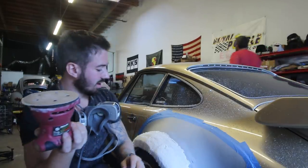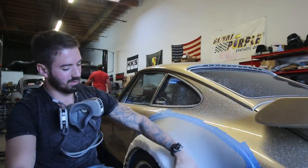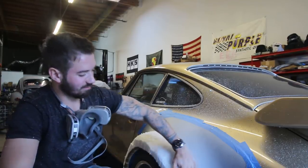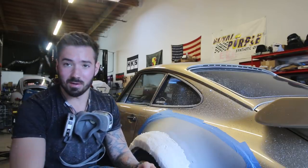Now that I've cut the bulk away with the knife, I've switched to the sander. That gives me a little bit more control over how much material is removed. At this point it's just like any other standard bodywork, but I don't really have much besides the stock fender to follow. If I mess it up I guess I could spray more foam.